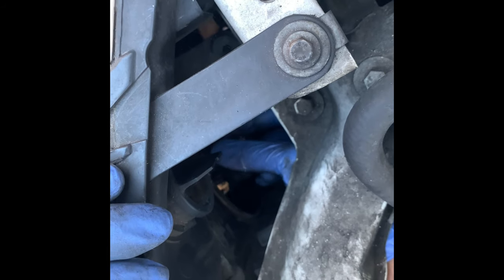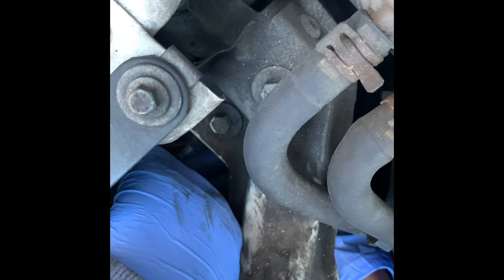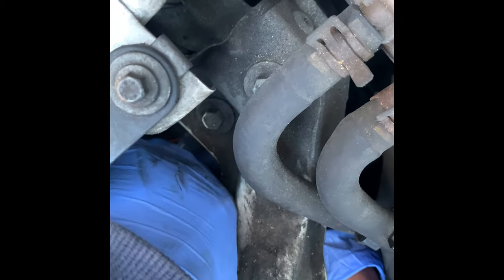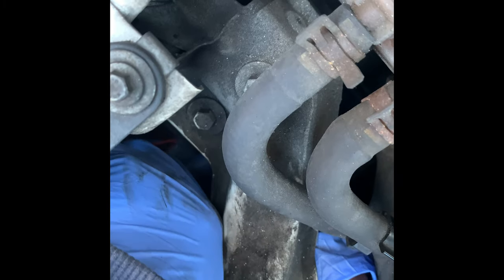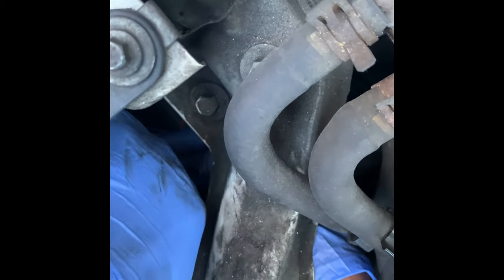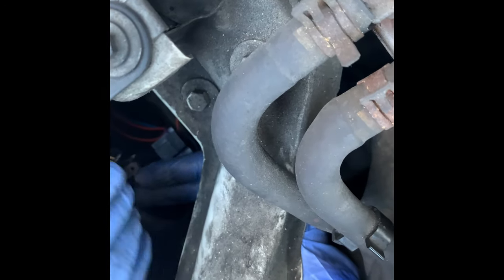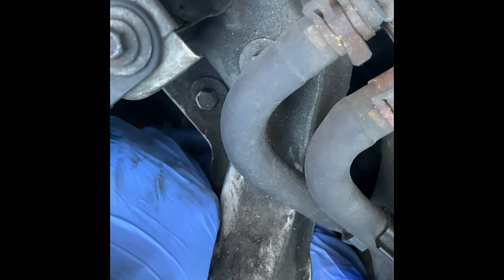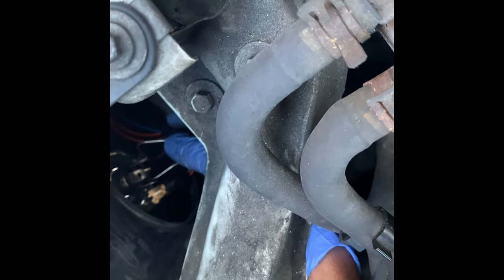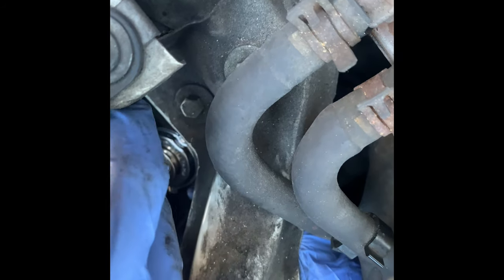So you just wiggle off the connector from the back like so, and then we have to take off the housing clip, which I'm just guessing because I can't see. Yeah, okay, so there's one that way and there's one that way. Okay, excellent. So that's the bulb out.